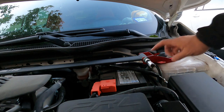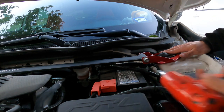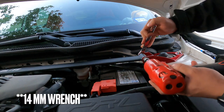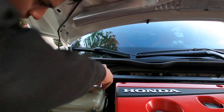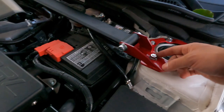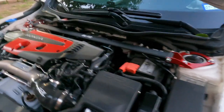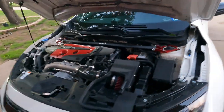This screw right here is an allen screw. I'm going to start threading on the nut, and I'll take off my reservoir cap to get better access. It's a pretty simple straightforward install — make sure you have the right allen key size, a 14 millimeter wrench, and your 14mm nuts for the strut towers. It's already installed and it looks good — I love how that looks in the engine bay. I did this more for cosmetics and the strut bar looks really nice.